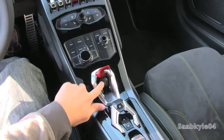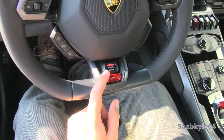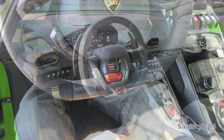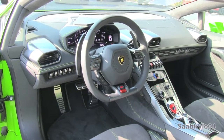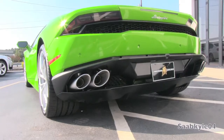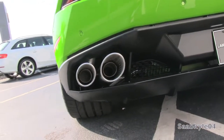We'll discuss driving modes more in a second, but a quick fun fact, if you manually select Sport while in accessory power, you can go ahead and open up the dual mode exhaust, allowing for a louder sound upon startup. The dual mode exhaust with vacuum actuated bypass valve is standard. In Strada, it opens automatically at 4200 RPM, but remains fully open in both Sport and Corsa modes.